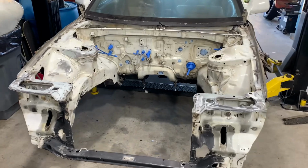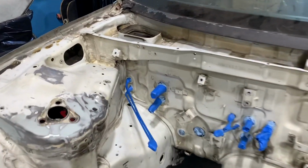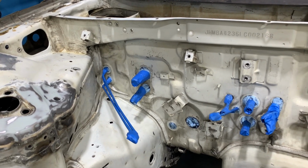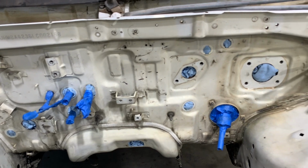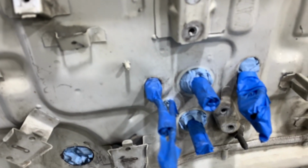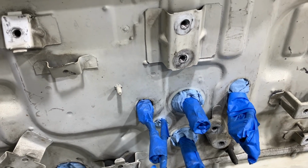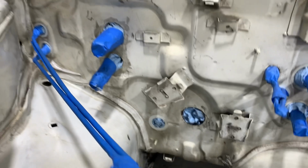Those are the things that are going to make all the difference on the quality of the paint when you're done. Lastly, anything that's not going to be completely removed before you paint the engine bay needs to be masked off. While there's many different ways to do this, I like the typical masking tape, and then I just shove some rags around the edges of all of the seals and holes so that any additional paint that might try to sneak in to behind the firewall is actually absorbed with the rags themselves.